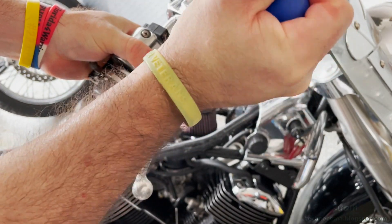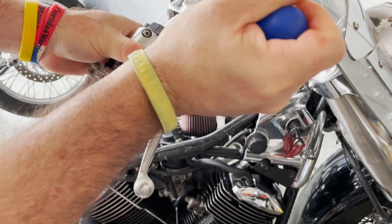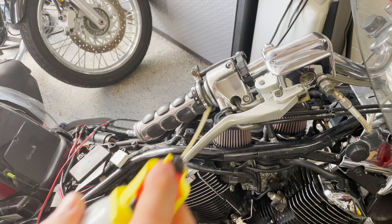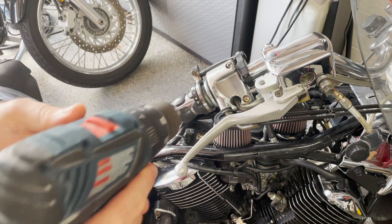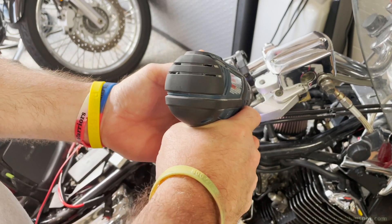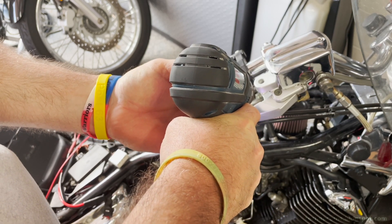Turning is attempted but I could see the metal fatiguing around the bit. It doesn't look like this is going to happen with a screwdriver. I know from looking at the setup that if I could get the head off there's a good amount of stud to work with on the other side, so first I'm going to drill a small pilot right in the middle. That'll set the bit for the subsequent bits that'll go wider to take the head of the screw off.